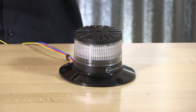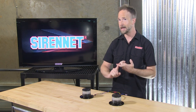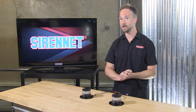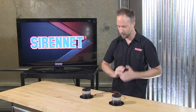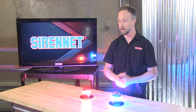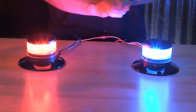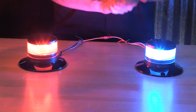These guys are so tiny, but when it comes to their output, they are SAE Class 1 certified and IP67 rated — that covers resistance to the elements and condensation. You can also use them in California, as they meet Title 13 compliance. For other certifications they meet, that's something you can find in the tech specs on the product page.